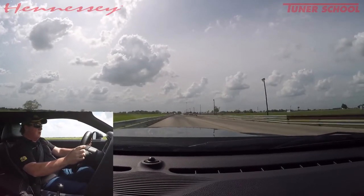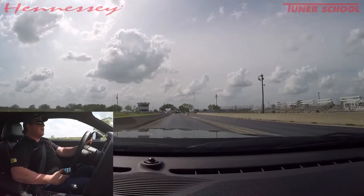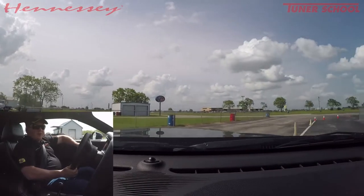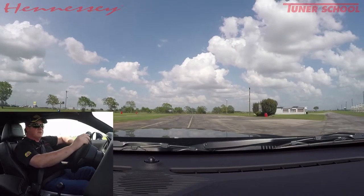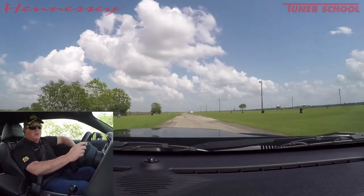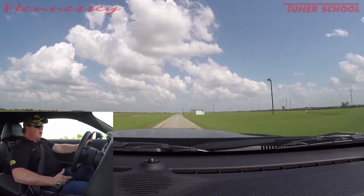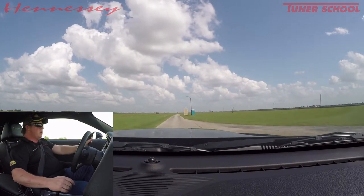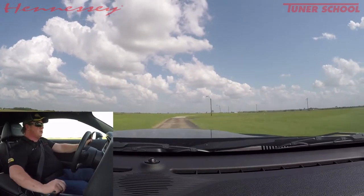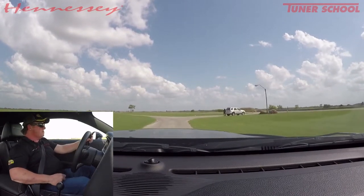A little no-lift shift from third to fourth. The other thing I love about the Hellcat is you can just beat the piss out of it all day long. The guys at FCA SRT did a great job designing a supercharger system with great heat capacity — it can dissipate heat whether you're drag racing or road racing. Compare that to the LT4 in the Z06 Corvette, which gets hot easily. When you've got a physically larger displacement supercharger like in the Hellcat, that helps dissipate heat.